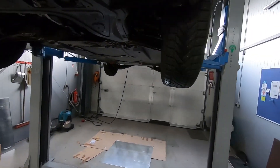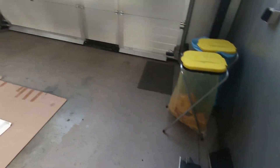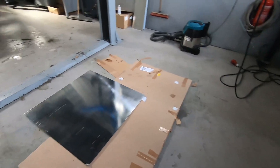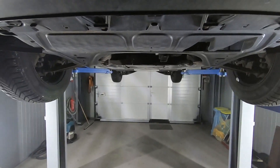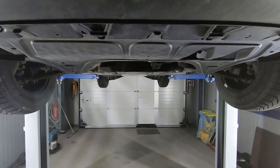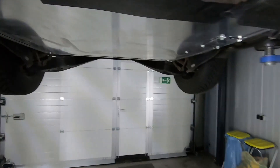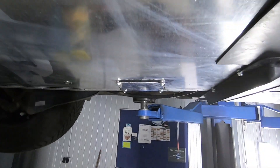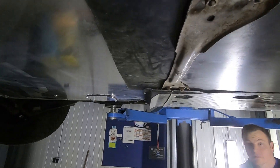Here is my battery cover. This used to be a nice sieve-print plate with various plastic parts, and it's now been replaced with this super clean and chic aluminum plate. What we have here is a service disconnect maintenance opening, so I can now turn everything on and off. The aluminum plate is 2 mm thick, which means I now have more ground clearance.